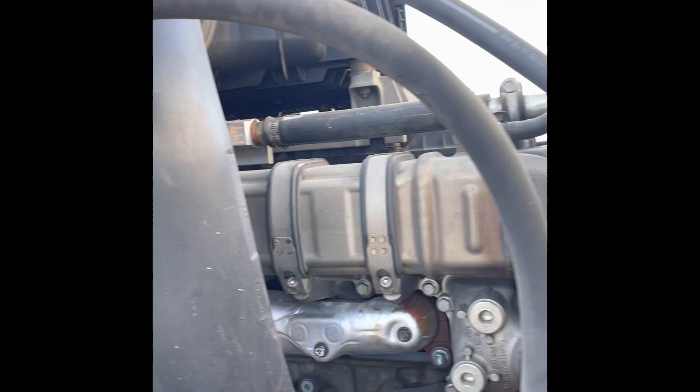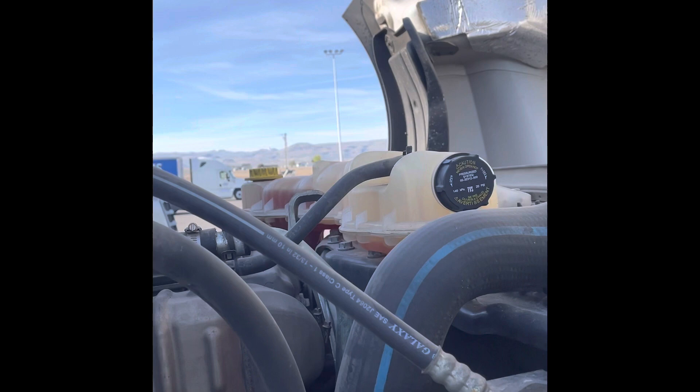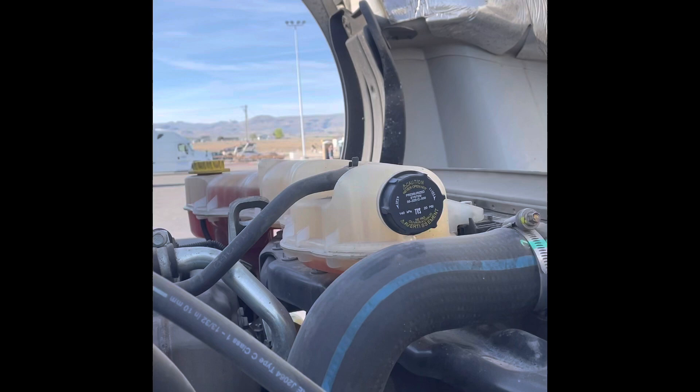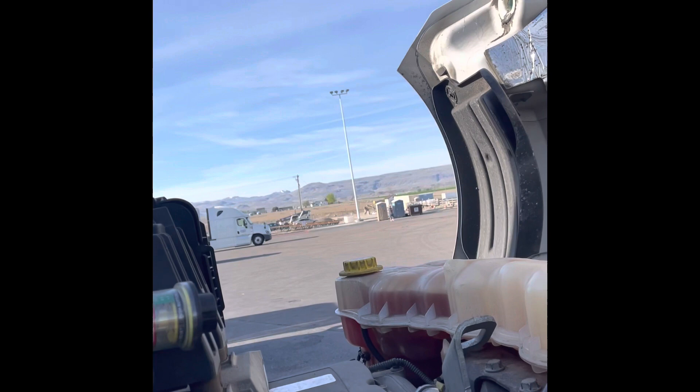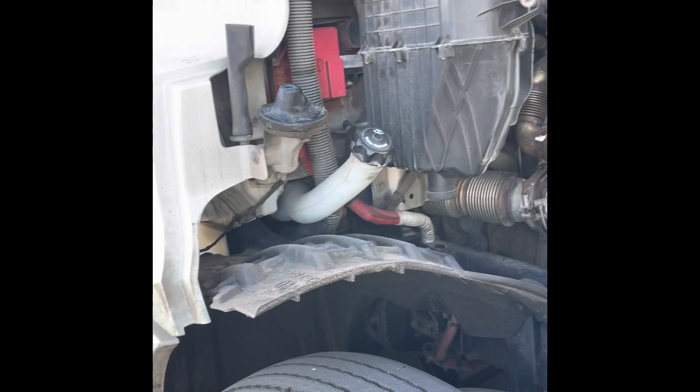On the engine you want to make sure your fluids are in the reservoir. This is a 2018 or 2019 Freightliner Cascadia, so they have an extra second reservoir on the right passenger side. That's why it looks so low — this is the overflow part. On the other side is the main reservoir tank up high, so it's got a second runoff.